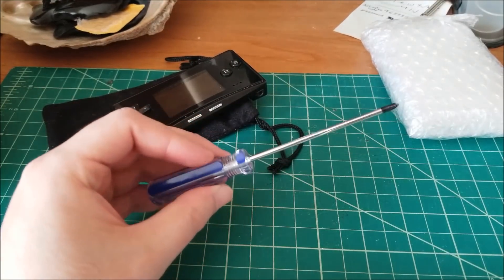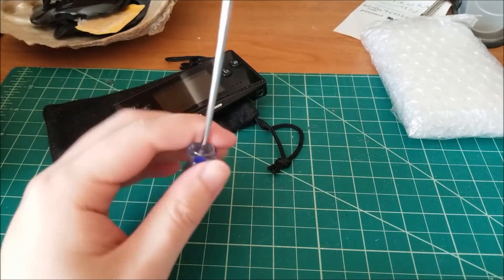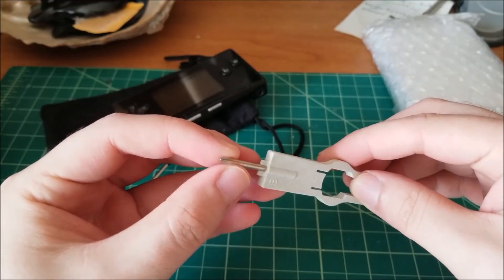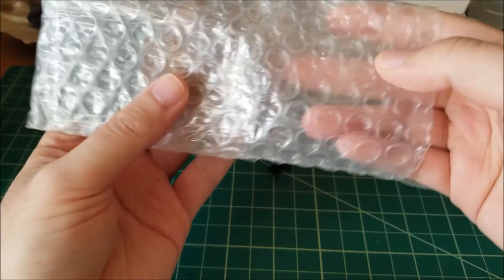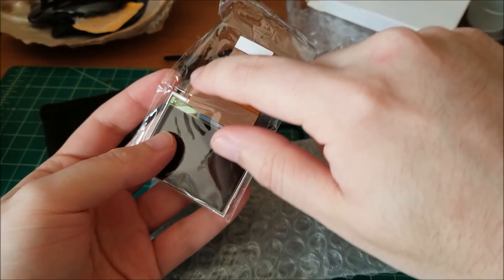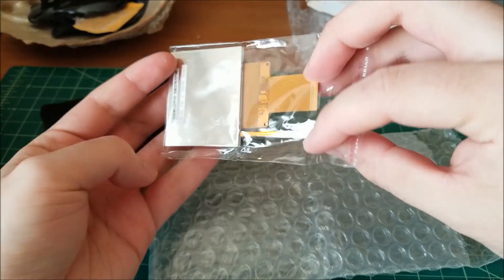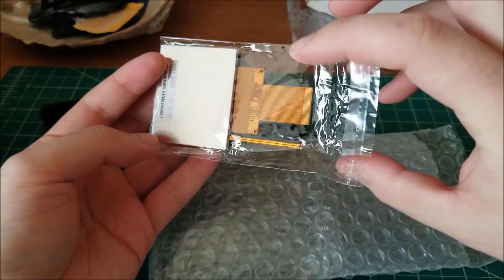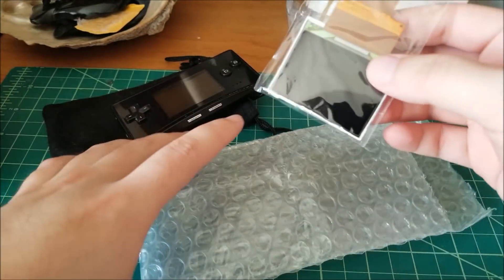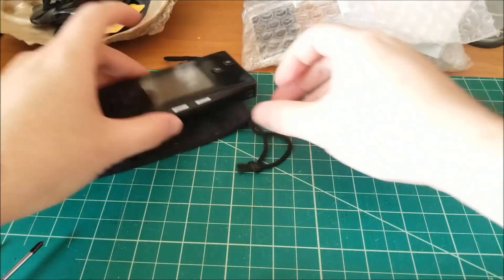For the repair, a pair of tweezers will help. Having a tri-wing screwdriver is a must, as well as a small jeweler's-size Phillips. This guy is the replacement LCD — it has the backlight ribbon cable, and this is the data ribbon. You want to be very careful with the ribbon; any overly bending could actually break it before you even get to install it. So I'm just going to keep this safely tucked in here while I take this apart.